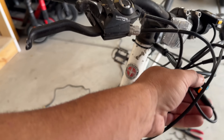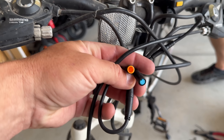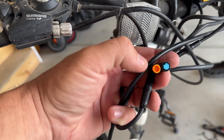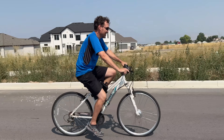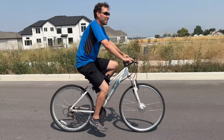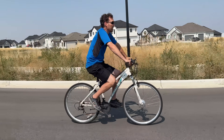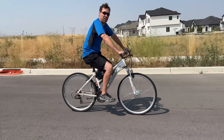That is pretty much it. We're thinking — and I'll put a link in the description if this is true — but you have two ports here. I'm betting that's for a headlight and for a throttle. Start pedaling. I want to see how reactive the sensor is. Stop pedaling — does the power cut off pretty quick? Yes, it does. About a full revolution before the power comes on, and about three-quarters of a second before it turns off.